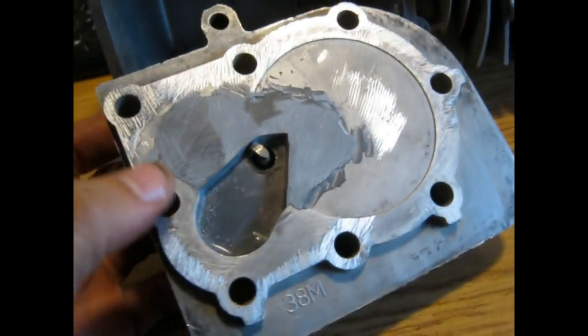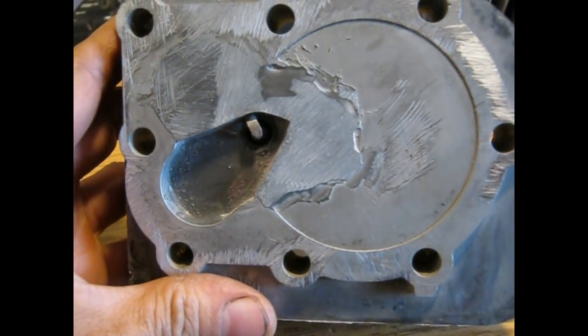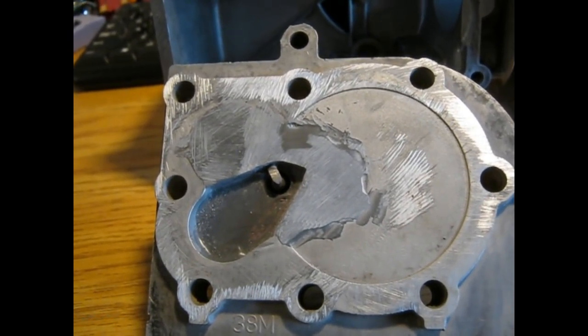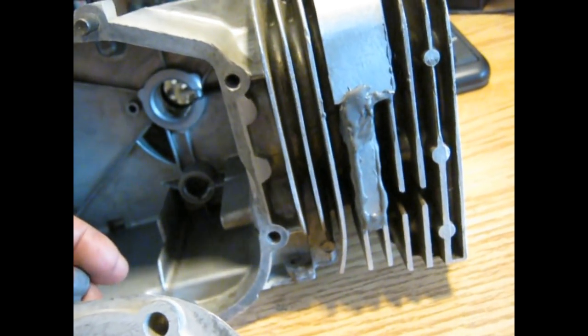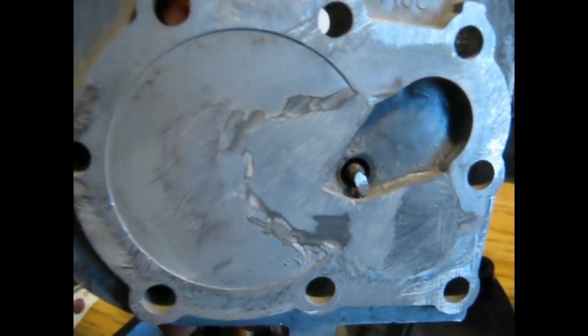This is the cylinder head. You can see the intake valve area will not be opening since it's flush with the head and filled with JB weld. I've filled in the combustion chamber as much as I can trying to increase compression. This engine takes in a full charge of air and fuel but only burns about one-fifth of it, putting the other four-fifths out the exhaust valve for cooling. I left the cooling fins on just for structural strength — I don't want it to blow up on me. It just fits on top here, open over the exhaust valve.